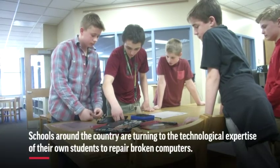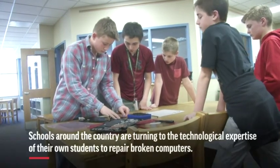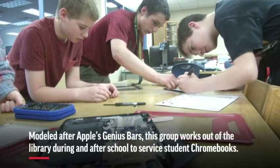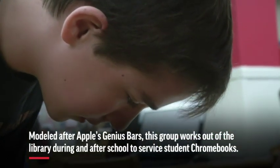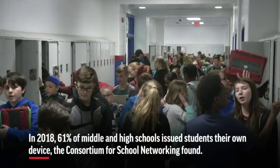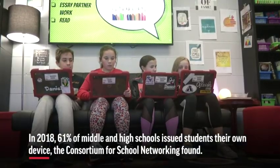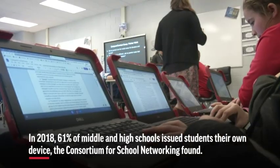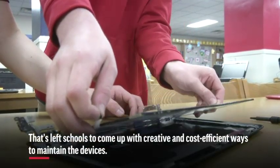As you can see, it's pried up already a little bit right here, so it's easier to get the spudger under one of the corners usually. You can kind of set it in there with your finger and kind of start turning it. Make sure that tape is out so that once you lay it down and it's in position you can proceed.